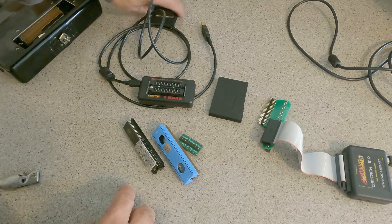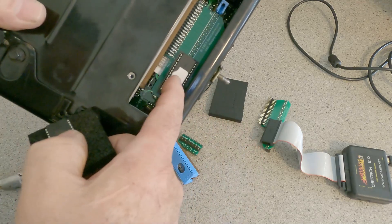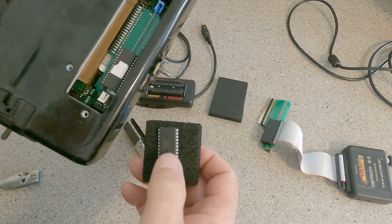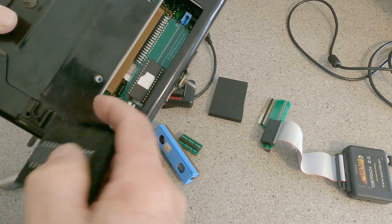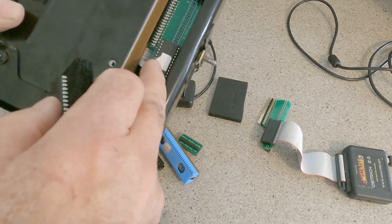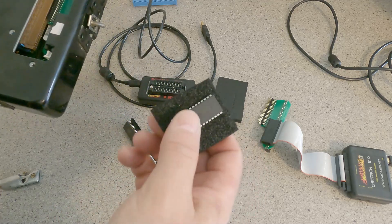These chips are sold by BoostedNW — get yourself a couple and mark them, like A and B. I've got two: one with tape on it. You can burn one and just pop the other one in and out, or you can have two different tunes. Say you have one for street driving and one for when you go to the drag strip — swap them out when you get there, swap them back before you drive home. That's what makes this really nice.